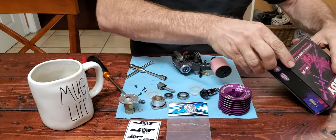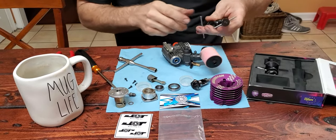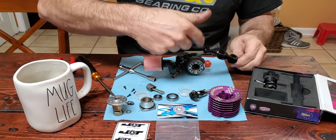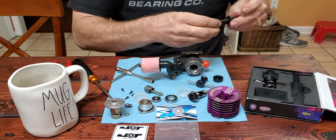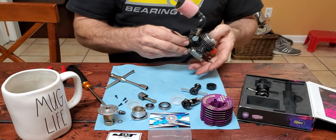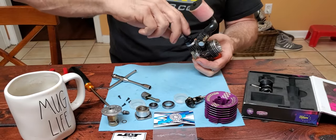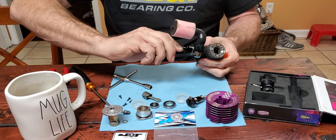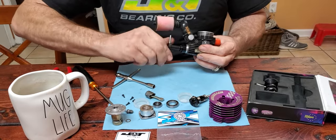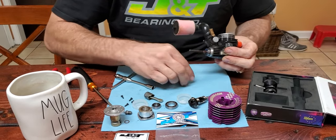So I'm going to use my handy dandy Hoodie tool kit bearing removal kit. First, you're going to pull the front bearing out. Use this piece. So you got these two pieces going here. They go in through the back. And this piece here, you simply screw this down and it'll push the bearing out. It popped, it's releasing and it's pushing it through, pulling it out right now. You'll feel it release just like that. And there you have that bearing.